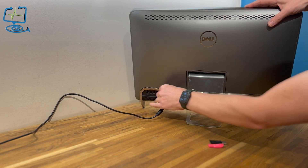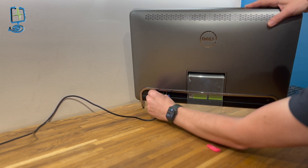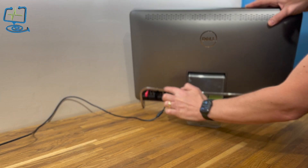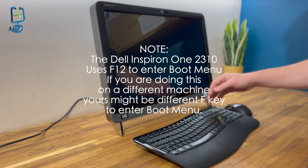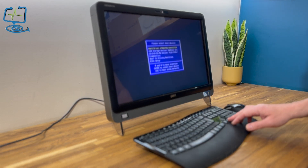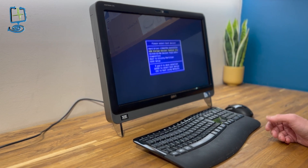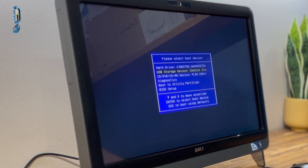Now we're ready to put the USB into the back of the machine. I'm plugging in power, a wireless USB keyboard and mouse, and my USB pen drive with the Windows 10 installer. Put those into the two USB slots on the back, flip it around, and switch the machine on. On this particular Dell, press F12 for the boot menu. Keep your finger on F12 while starting the machine. The boot menu comes up — select USB storage device, which shows as SanDisk.